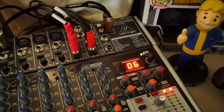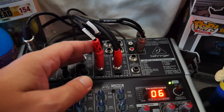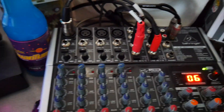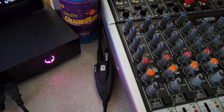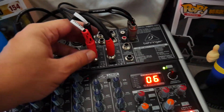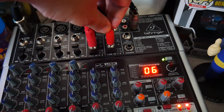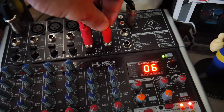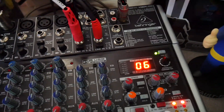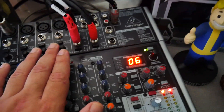If you want to take it to the next level, then we can start focusing on this. This is my PC audio in. This is my TV audio in, and this is the board audio out. Because my computer does not have a headphone jack and a microphone jack, I had to buy a USB sound card which gives me a headphone jack and a mic jack. This is the headphone jack sending audio out of my computer into here. This is another audio in coming from my TV because my TV doubles as a monitor and it has a 3.5 millimeter audio out jack, so that's putting my TV audio in — otherwise I wouldn't be able to hear my TV. Any sound you want to hear has to be going through here if your headphones are plugged into this mixer.